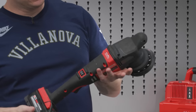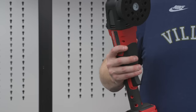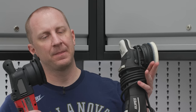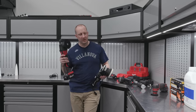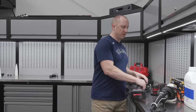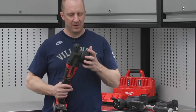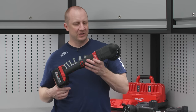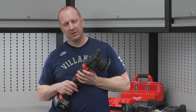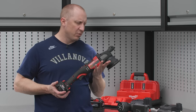Milwaukee, I think, is the best cordless 15mm or 21mm machine. This machine is about 90% as balanced as the Rupes, has equal if not possibly more torque, and doesn't have the pad stalling that the Rupes has. This is free-spinning — no need for any washer modification. The Rupes, even mine that's very worn in, doesn't spin freely. Milwaukee got it 90% right out of the box from a company that doesn't know jack about doing this kind of stuff. I spent about an hour and a half with them during the development phase, recommended some friends get these machines and help provide feedback and testing. This particular machine is really well balanced.